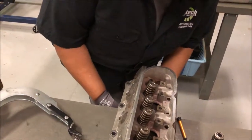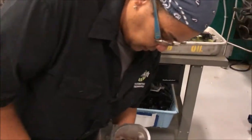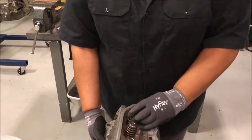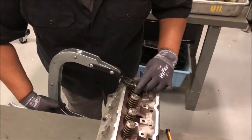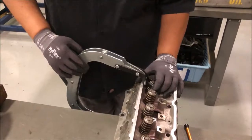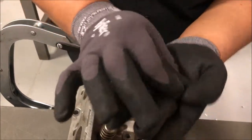There's a procedure that you can do that helps to make the margin match very well. We'll push up and take our spring, put that back on. We're going to take our compression tool and put that back on, making sure that we keep everything in alignment. That has to go to the hilt and the bottom part has to be on the head. Then we slowly push that. Now we're going to take our valve keepers — one side is larger than the other, and it has a little divot in it; that's what keeps it inside.